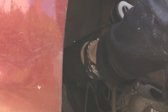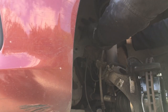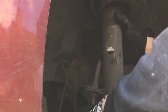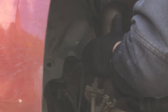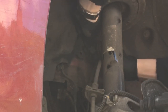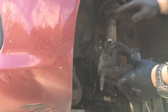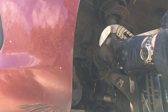There's an 8 millimeter retaining bolt on this inner trim and a little clip - pull the center out and the whole thing comes away. You can then lever that inner wheel arch back; you haven't got to take the whole wheel arch out, just lever it back, which reveals the clip. These are just pressed in on plastic clips, so you pull them out, pull the clips away, and that wire will just come away. It's a push-fit connector to remove that brake wire - squeeze the little tab on the connector and pull it apart. Out with the old, in with the new.